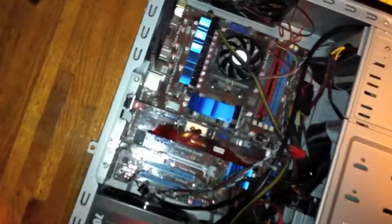After you unscrew, disconnect your power adapter — your 6-pin, 8-pin, whatever is plugged into it, unplug that. If it's PCIe, there's a tab here that you push down on, and then your video card just comes up. Push the tab down and pull up, and the video card should just come out.